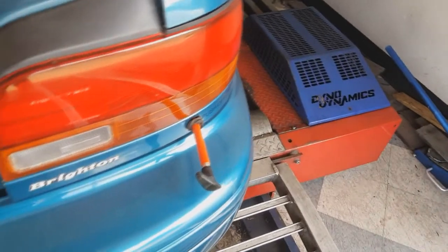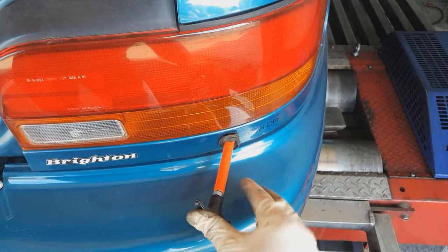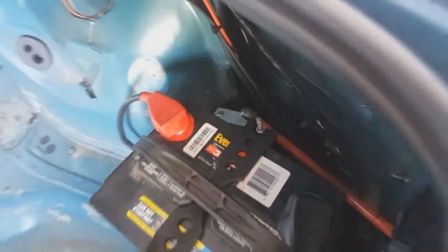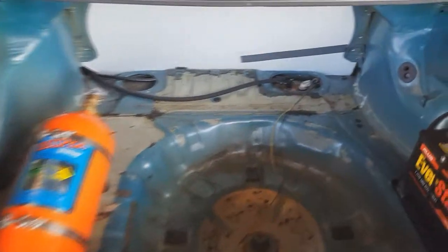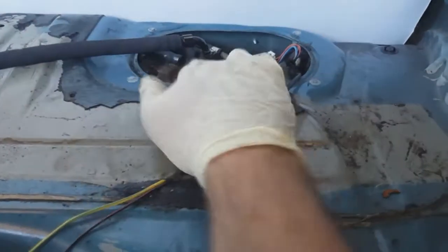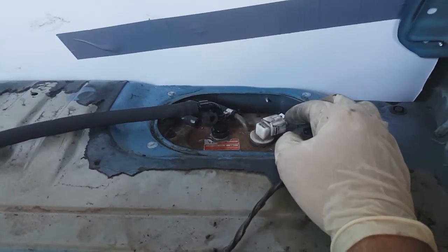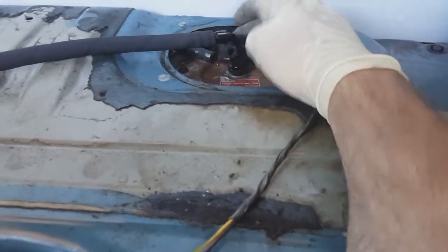The reason I have to have a firewall is the battery in the trunk — it's not a sealed battery, just a normal lead-acid battery, so NHRA rules require a firewall from the cabin to the back as well as a cutoff switch. This is a push-pull style: push for off, pull for on — 'push off' is the required sticker on that switch. Down there you can see it — just a generic JEGS brand switch. There's also a bulkhead fitting for a dash-6 feed line from a Walbro 465 high-output E85 pump — though we're actually running methanol fuel, not E85. That's the feed, and this here is the return.